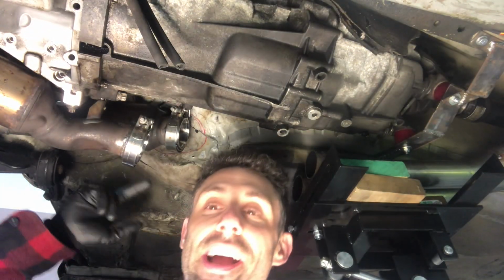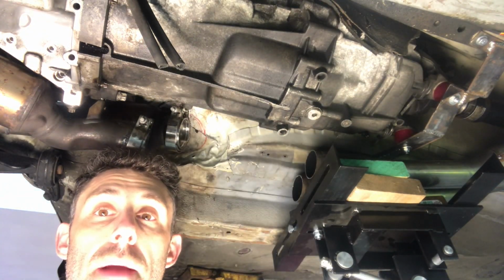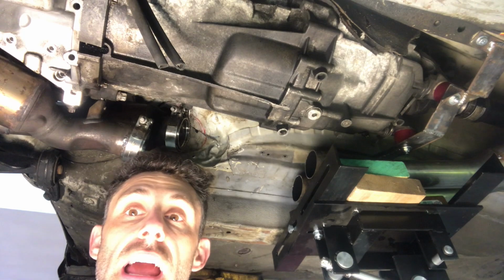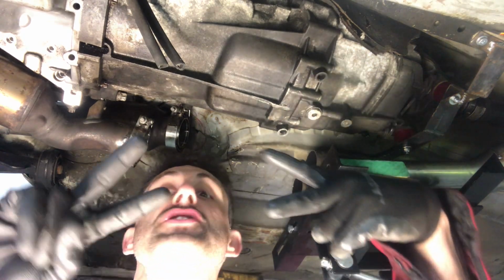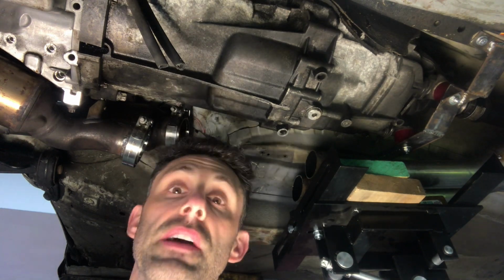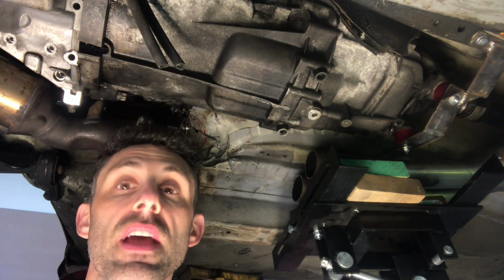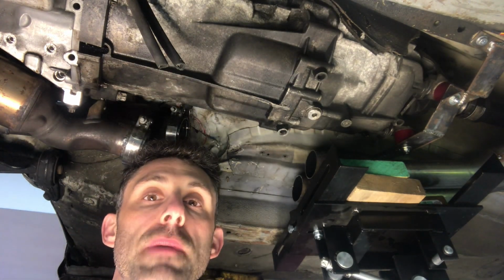All right, so I got these two exhaust headers and I got these two open pipes coming from the X-pipe, and I need to mate them together. So the question is, which one of the two do I want to mate together? Technically, it really doesn't matter because the lengths are just about the same, and everything from here on back is exactly the same in terms of flow. So I'm not really too concerned about that. It really just ends up becoming a logistical question.